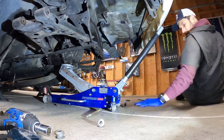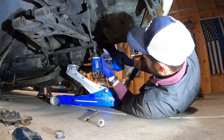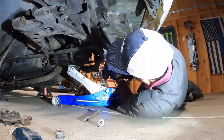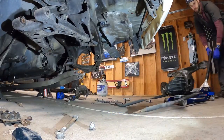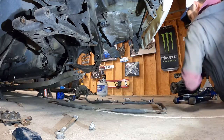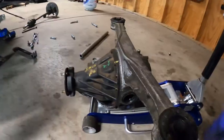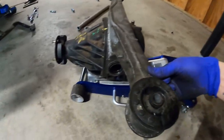Got the axles up. Now I need that last important piece — there she comes. I'm staying off it and just pulling out the rear brace — drop right down. This piece should come out with six 17mm bolts. I'll just put it back up there. And that's how you remove a diff out of a Miata. I'm not really sure how to figure out if this one has a limited slip or not — I'm going to have to look up model numbers and figure out where that's at. That's going to conclude today's video. Thank you all very much for watching. Peace out — keep turning those gears.